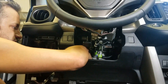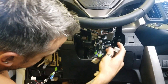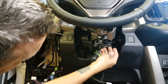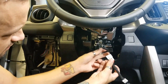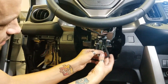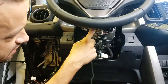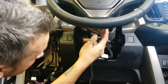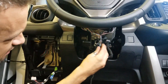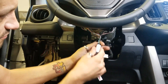I'm going to pry this little under-dash panel down and run them up through here. The 7-pin goes to a black connector on the right-hand side — it plugs into a big silver box-looking thing. There's only one plug that it looks like the 7-pin fits. We're going to undo the factory one and put our T-harness in. The 5-pin is way up here, closest to the steering wheel itself — it's just a little black plug.